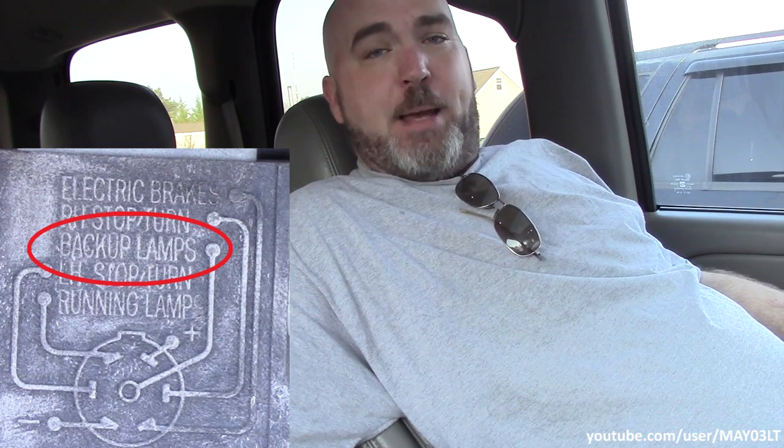The cover has a dedicated pin for backup lights — reverse has nothing to do with what we were doing today. From my limited understanding, auxiliary batteries are only going to get like a 9 or 10 amp charge from the alternator when the truck's running. I would just use a 30-amp fuse to protect that circuit. The whole purpose of finding this source of constant 12-volt power is going to play into a modification I have coming up on this truck. If you want to see that, be sure to hit that subscribe button. Thanks for checking out the video — I hope it helped you out.